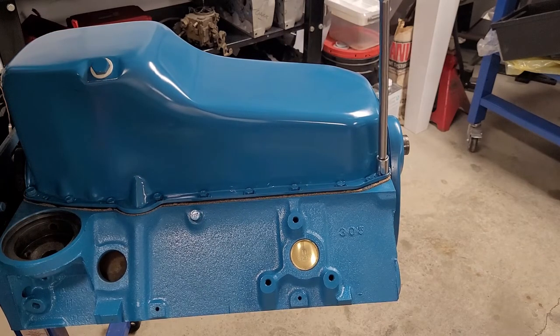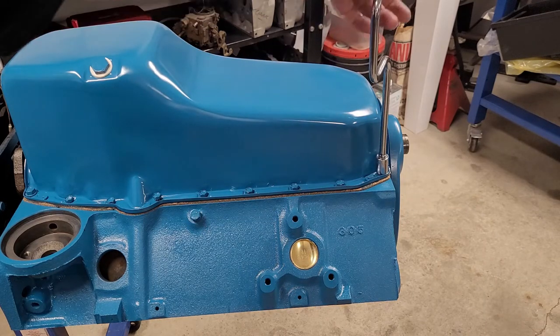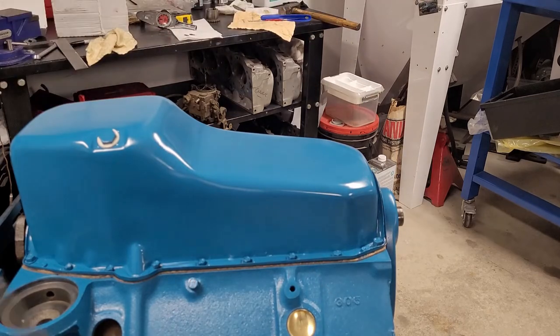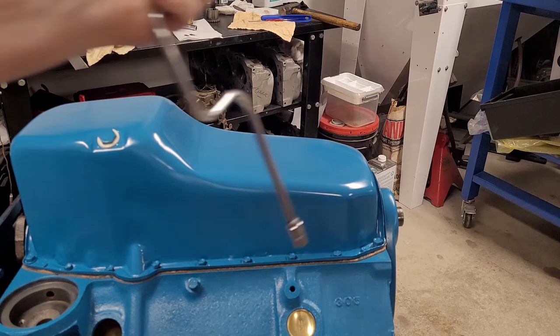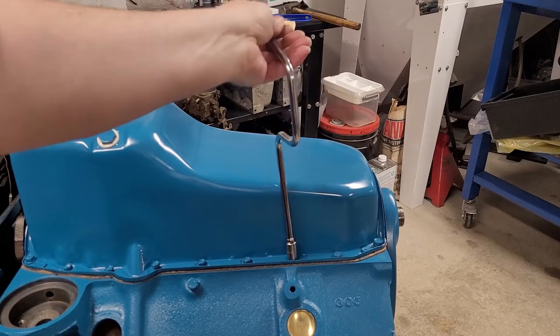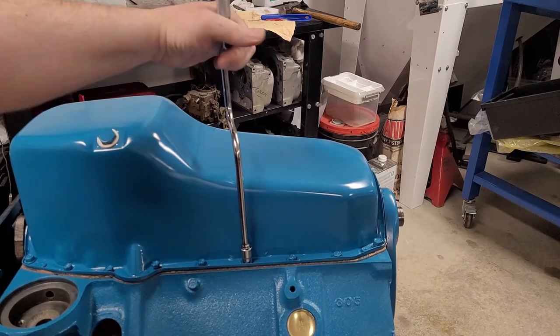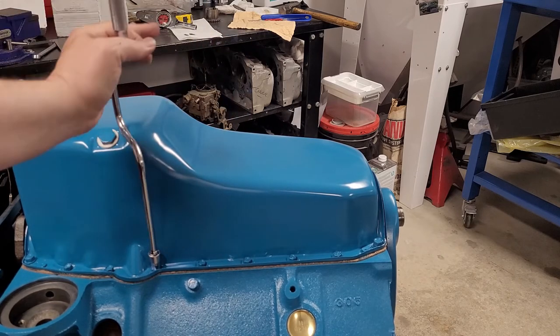That's my experience anyway. So let's just say we did that all once. We're going to do that three more times. All I really like to do on these cork gaskets is just a little bit of torque, right? Just a little bit, and we'll go around and do each one of them. Now that we know it's even, you might find that most of these are loose again. That's okay. Just make them all the same as you go around. And by the third time, they'll be getting pretty snug and that cork gasket will be compressing a bit. And we should be okay.